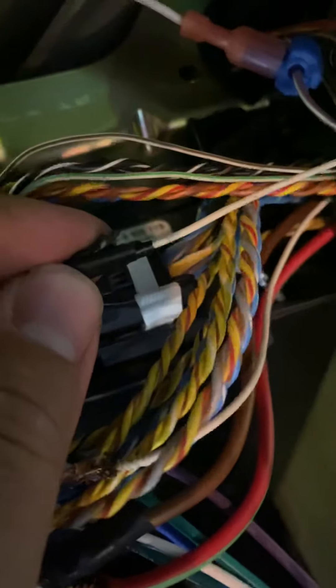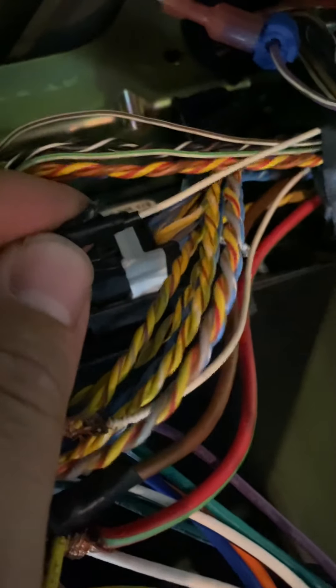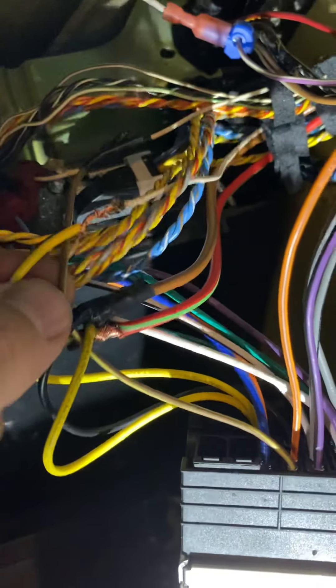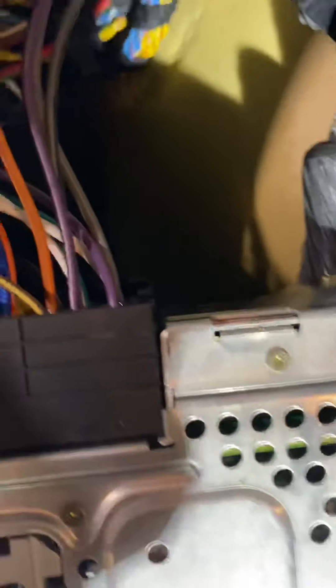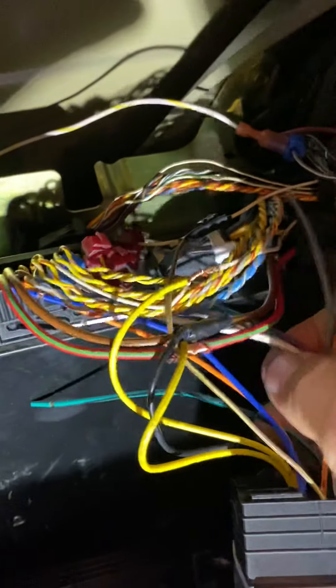The last cable is the iBus cable — this is a little harness behind the big one. This wire is all white and has about six volts going through it. If you have a multimeter, rig it up and you'll see it's got about six volts coming out. That's your brown and yellow wire — those are the four cables out of this harness that go into your CD or cassette deck.